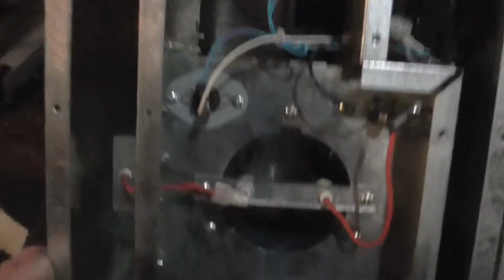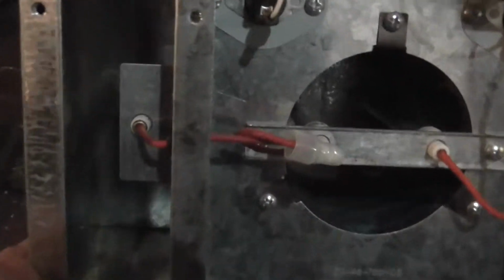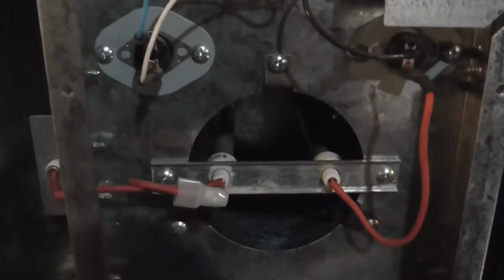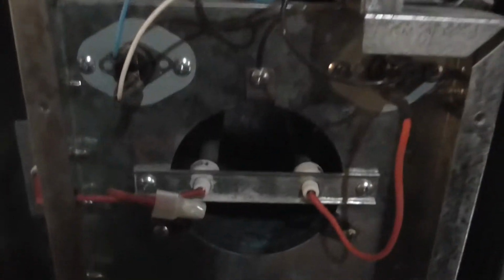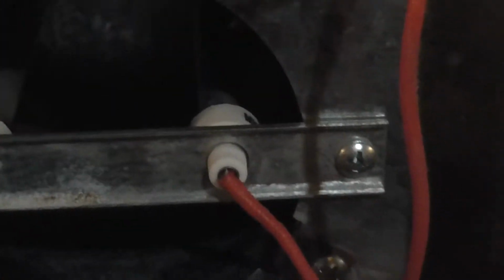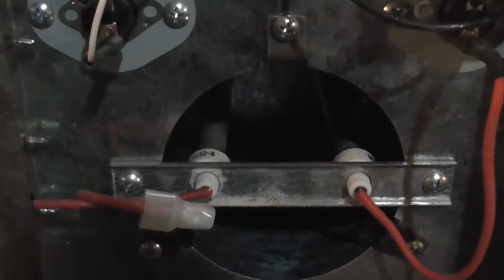Current situation at the picker compound. I got the side of the Eden Pure apart. I gotta check the elements right there. I got 3 of them in this one. The last one I fixed had like 5. So we're gonna pull out these 2 screws right there and there, and I'm gonna check the metal piece that's running in between the two, because usually they bust and it breaks the current and then none of them turn red. So we're gonna take the 2 screws out and I'm gonna check that really quick.